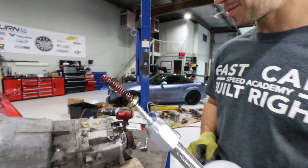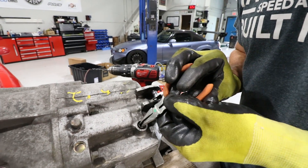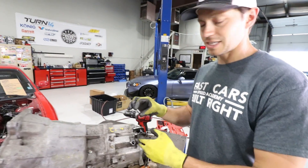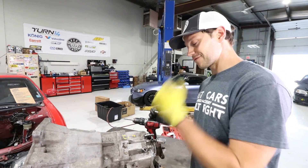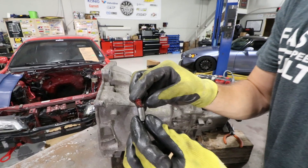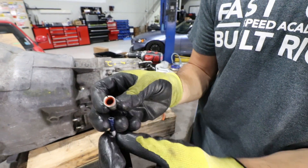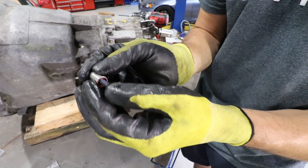This is the spring that we'll be replacing. We do have a new cap. Now we're going to pull out the sleeve - this one slides right out, which is pretty awesome, because apparently these can actually jam up in there, which is what I think causes the issue where it doesn't come back to center. This is the old version, which is a larger spring and sleeve, and here is the updated version - it's got another sleeve with a rubber coating, which I'm assuming doesn't cause it to stick, and it's got a smaller spring but essentially does the same thing.